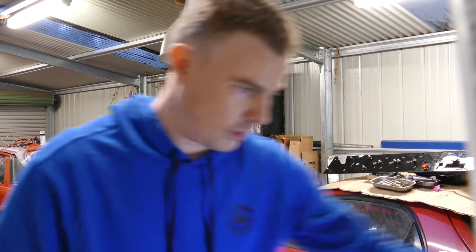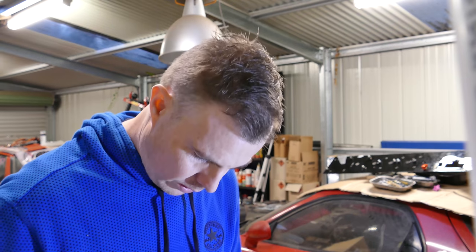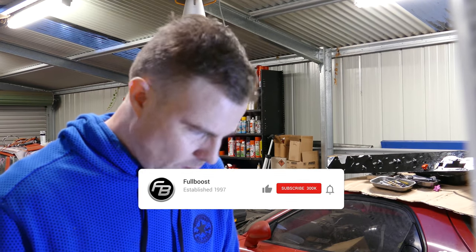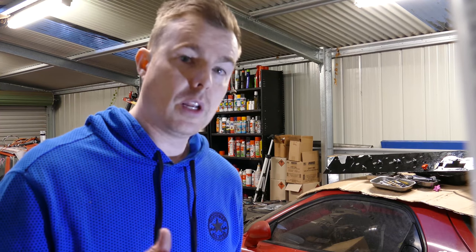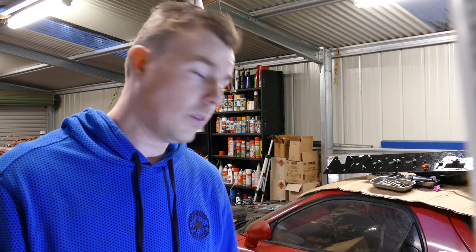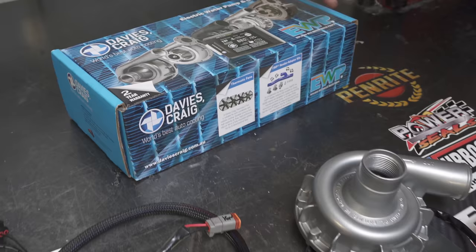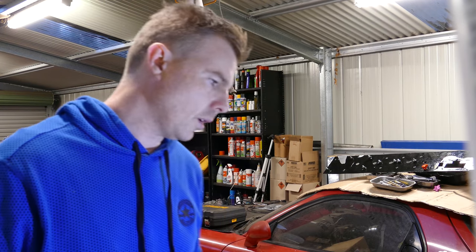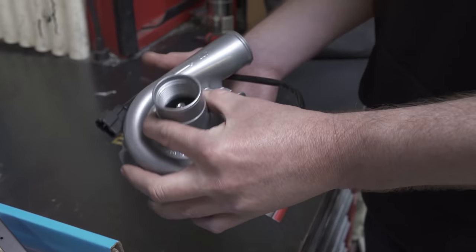I'm ticking off some of the other boxes. I've got an engine fan with fuses and a relay set up, but I'm actually not going to run that through the FuelTech now. Instead, we're going to make another upgrade to this setup — something I actually used to have on my FD. We're running a Davies Craig electric water pump. The reason is I was noticing that when I turn the car around quickly between rounds, with fans running to get heat soak out, if I was leaving the car in the pits for 45 minutes, water temps were still around 70 degrees.